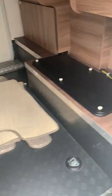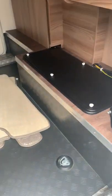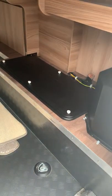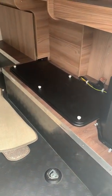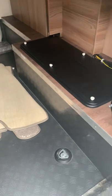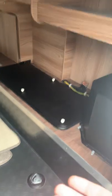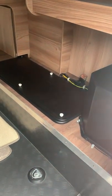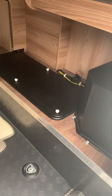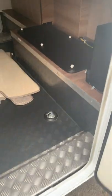Obviously it doesn't matter whether it's a new battery or not — they will drain out if you use it for too long without charging. If you have access to a hookup cable, it's really good practice to keep it hooked up every now and again to keep the batteries charged. If not, just take the van out for a long drive every once in a while to top them up.